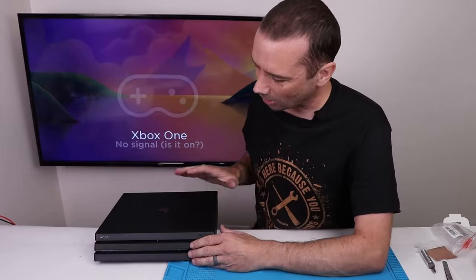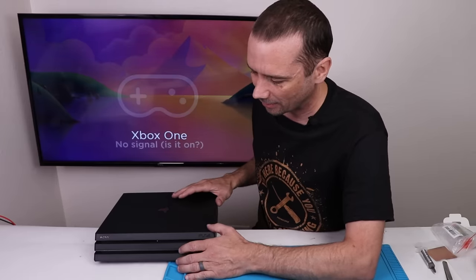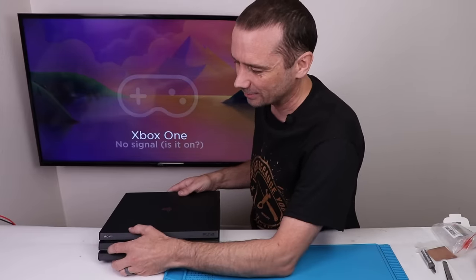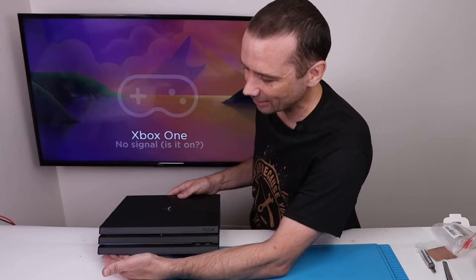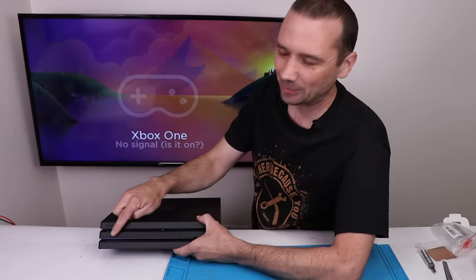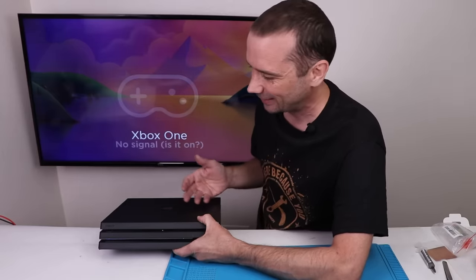Will the power supply connect? Let's find out — oh, I think that's it, connected just fine. Now we've got this PS4 Pro all fixed up, but will it turn on? It hasn't exploded yet, so that's good news. Let's start by seeing if the disc drive has power — oh, it does, that is great news. Let's try the power button. Good so far, I hear the fan going, we got a blue light, nothing on the screen yet. Still got a blue light — I hope this isn't a blue light of death after all that. And all we have is a flashing blue light. So unfortunately this PS4 has a blue light of death, but the good news is that we did fix what we set out to fix — the power supply connector.